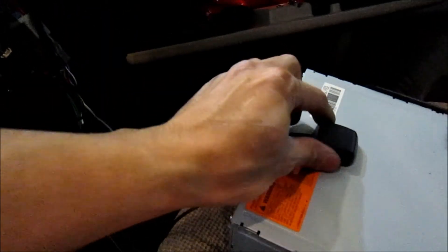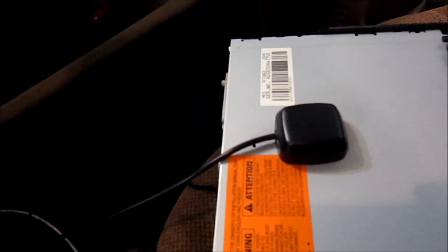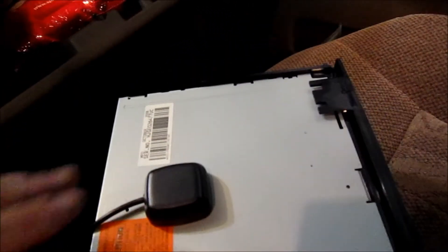I've also pre-wired and ran a fish line to route the USB into the glove box — keeping it basic. For the GPS antenna, I've seen a lot of people put it on the dash and it just looks ugly. There are so many GPS satellites now that you can put these antennas inside the dash. As long as there's no metal between the antenna and the sky, you're fine — fiberglass and plastic will transmit through. Placing it behind the dash saves time and makes the install look much cleaner and more stock.